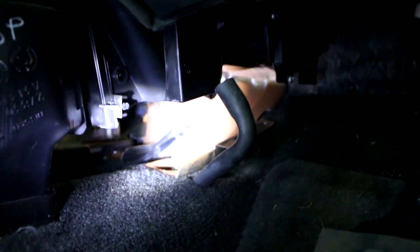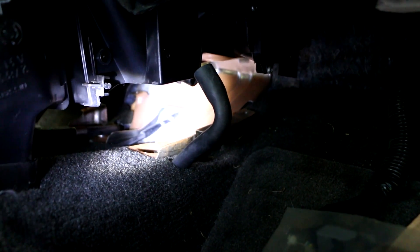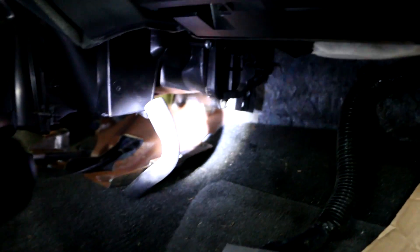There's the back of the cable where it goes through the firewall, but to get to it I still need to remove a metal bracket with two screws at the bottom going into the floor hump, and two more up underneath. I can feel them but can't get a socket on them — this is quite the kettle of fish Nissan has given us here.